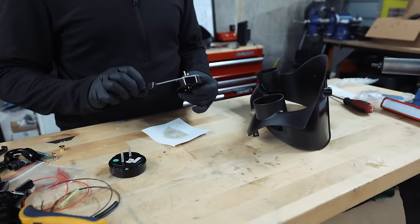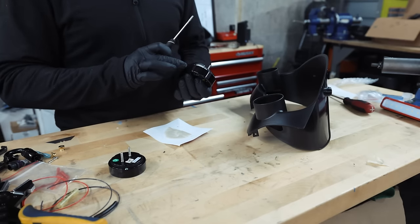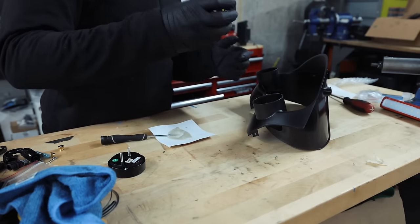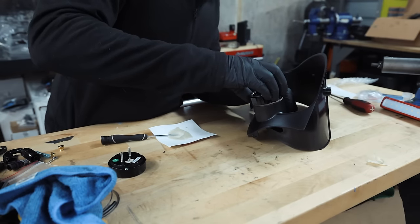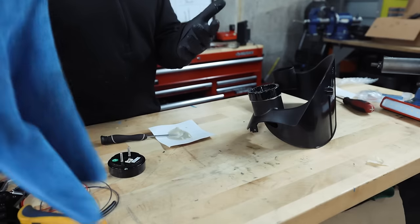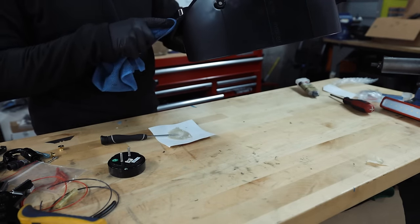When we go to put these in, we want to keep them in place for probably 20-30 minutes so it has time to cure up. If somebody has a better way of doing the X-series gauges in this style pod, please let me know. If you don't use the X-series gauges, you don't really have to deal with this problem — it's only the X-series. I'm going to load up some epoxy on the air-fuel ratio gauge, slide it in, make sure it's straight and level, and wipe up any squeeze-out around the side.